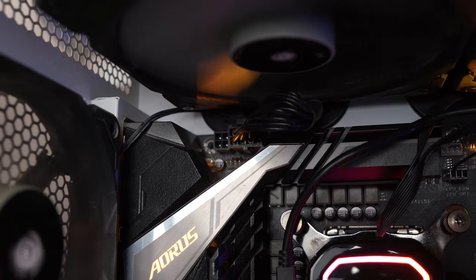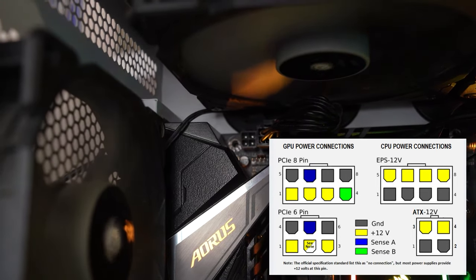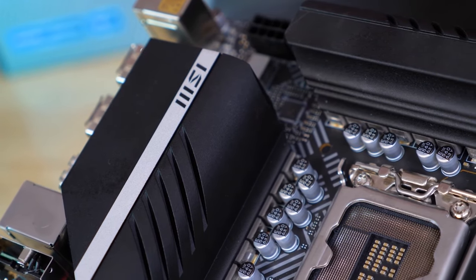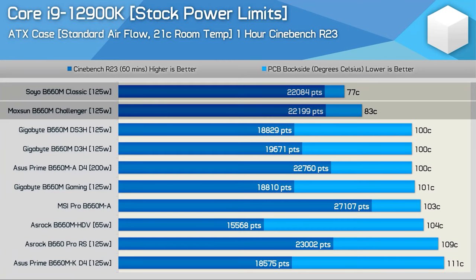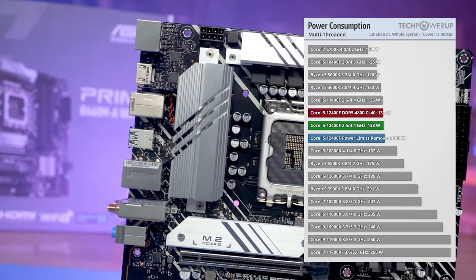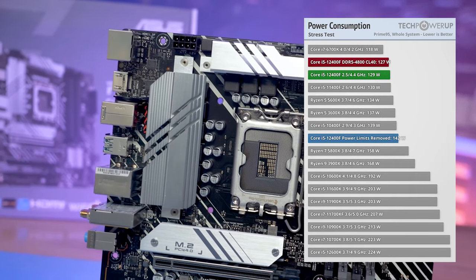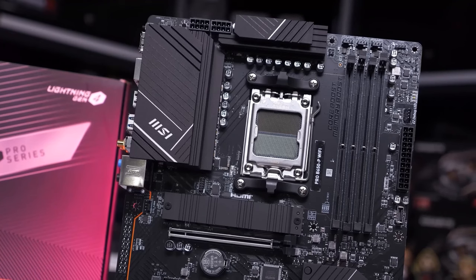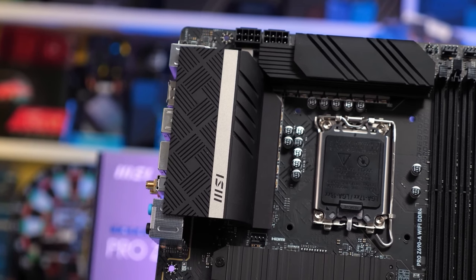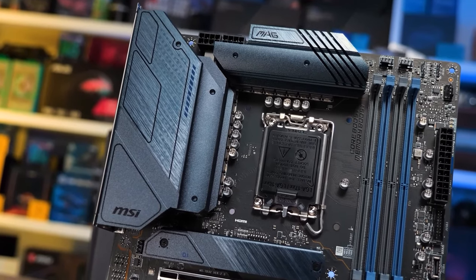More than 300 watts can be transmitted via 8-pin, which is enough for most top-end processors even under load. On top of that, usually the limiting factor will be rather the power supply zone of the CPU of an inexpensive board, which simply won't be able to supply the necessary current. And taking into account the fact that usually mid-tier Ryzen 5 and Core i5 processors rarely consume more than 100 or 150 watts in real-life workload, one 8-pin connector is enough with a good margin. Additional 4 or 8 pins are there more for complacency, and to give the board a top-end look. In fact, only few solutions on Z chipsets will be able to supply half a kilowatt to the processor, and they are basically toys for overclockers.